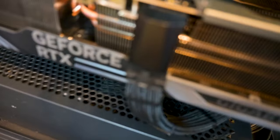Here we are running TimeSpy. I worked the memory clock up to 1,000, and then I've been tweaking up the core clock 20 at a time. My goal was kind of to get to 200. I'm in the GPU test number 2, and it's held through everything, so I think this is gonna be stable and give an even better score. I've been chasing, trying to get over 38,000, and we'll just have to see what happens here. 38,000 on the GPU score.